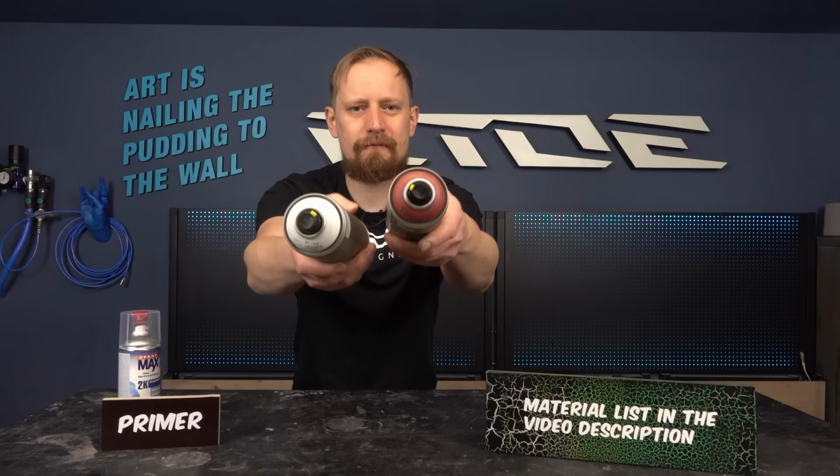The metal primer is for bare metal if you want to protect it from any rust and to give it a protection surface, that's the right primer. If you have an already painted tube on aluminum or on steel, you can use the uni primer. Okay, check these two. The metal primer, also the uni primer.